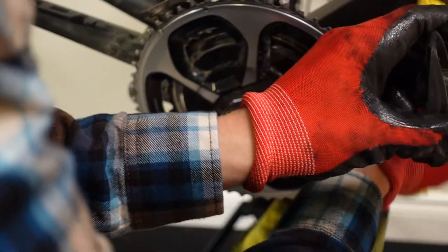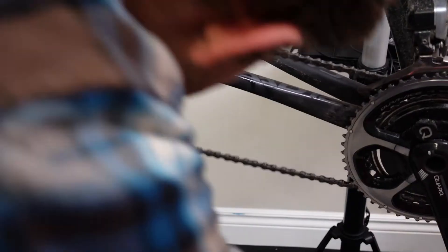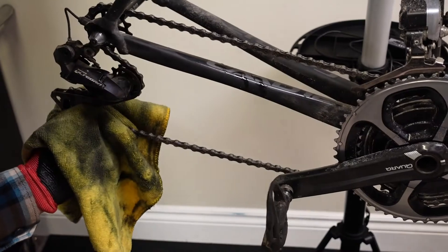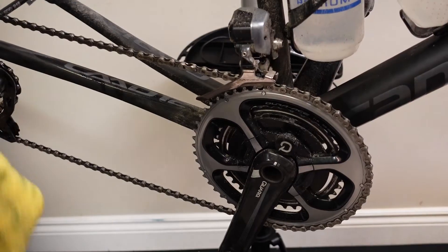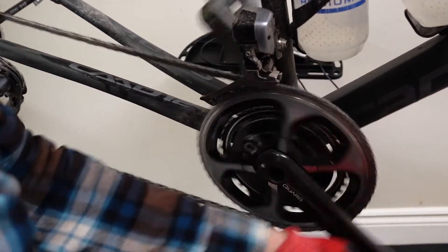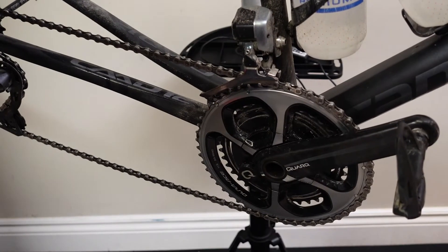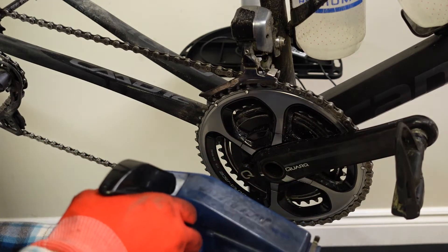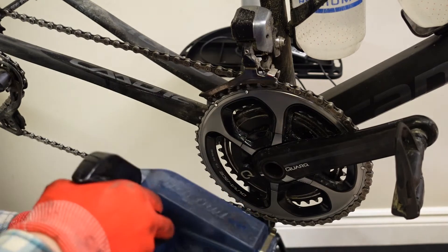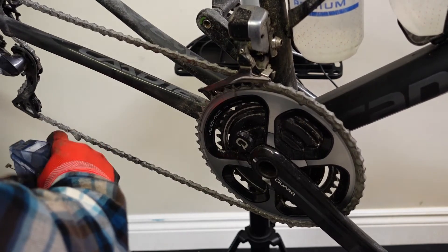I make sure to get in behind the crank, and I keep turning and turning. Now I take it off and wipe the chain down. I like to do the jockey wheels first — I have my rag held around the jockey wheels and I spin. Then I do the chain, kick it back up in the big ring, keep wiping. I find I can wipe the chain down really well when I hold and wipe while it's on the big ring. I wipe off the little ring. If I don't like the way the chain looks, I'll just add some more degreaser through the top hole to get it back up to that line, pop this back on the chain, and we spin again. That's looking much better already.